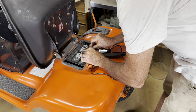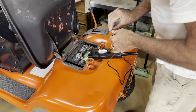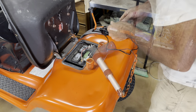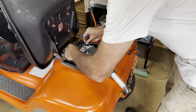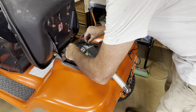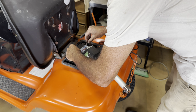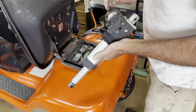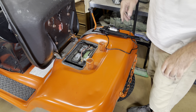This is supposed to do 600 pounds — it's the same four inch stroke. Let me get that old one just to verify for you that it doesn't work. Nothing that way. Let's see about this way. See, it's just not doing anything. It's got a little spark out of it. I'm sure it got wet and corroded inside. Maybe one day we'll take this apart — I'm not going to throw it away. So I know this new one works. I know what the problem is now.